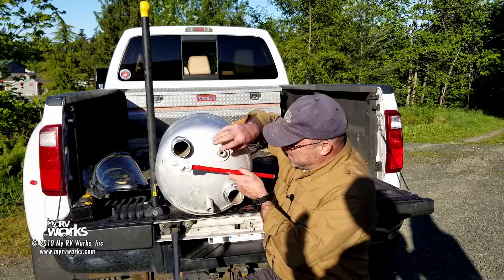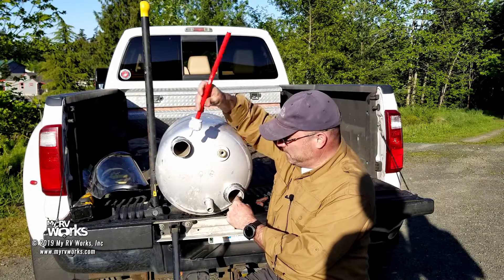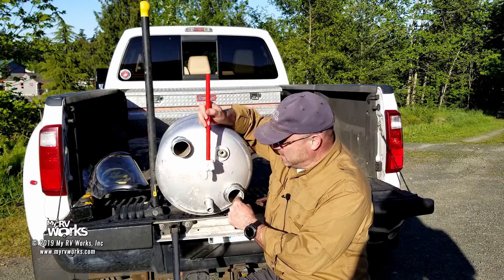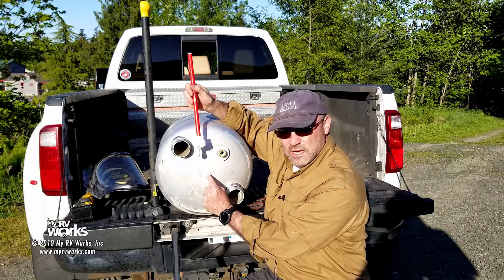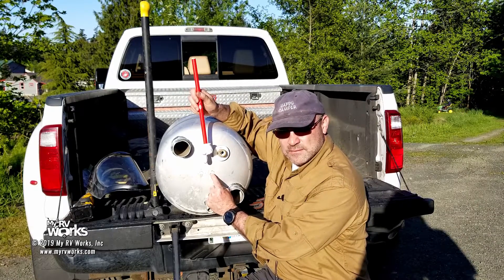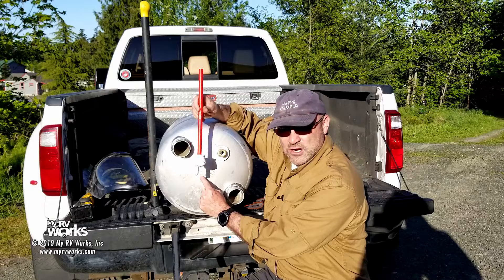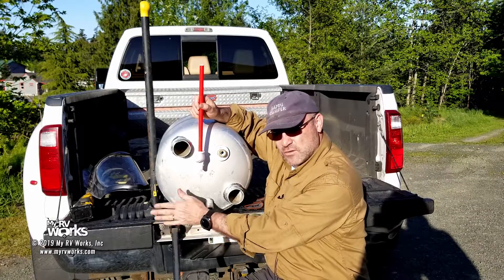What you see on the front is where the gas goes in and where the exhaust comes out. Here's your pop-off valve, and down here is your drain valve. Now you'll see some little marks right here — this is where your thermostats go. Temperature one is a regular thermostat, about 140 degrees is your average turn-off. The other one is about 180 degrees — the 180-degree one is going to be the one that turns your gas valve off. Gas valve is sitting over on this side.